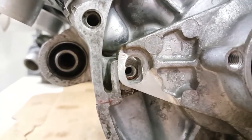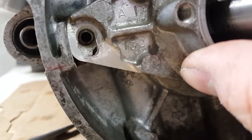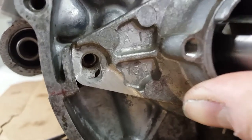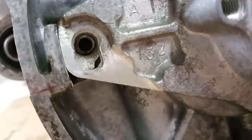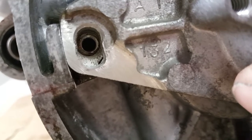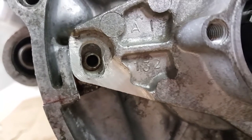There you can see I have my marks on there. Right there is stock — you can see the bolt hole is lined up with the original hole, and it's lined up with this top piece. And as you turn it, you have one, two, three, and right there is about four degrees.